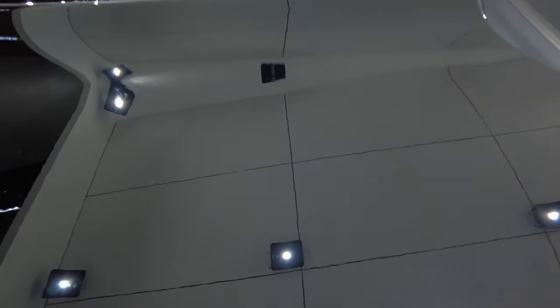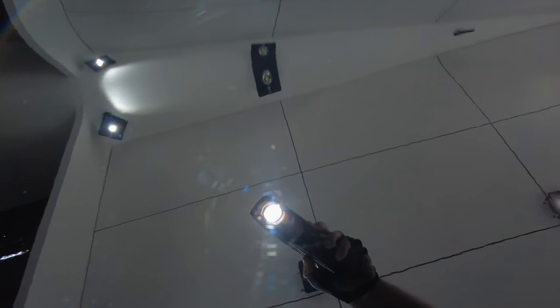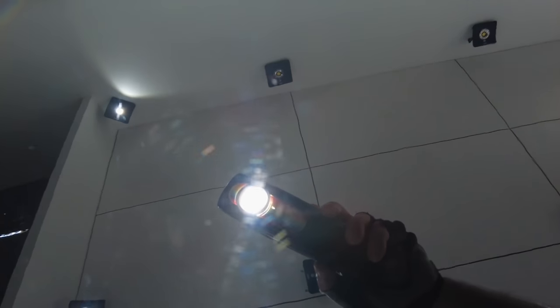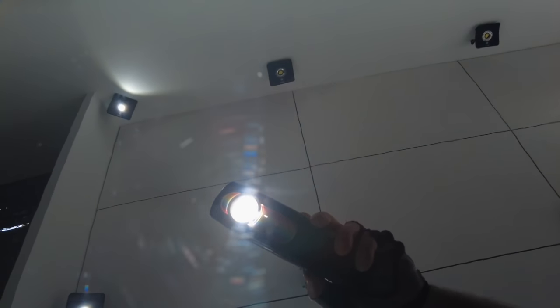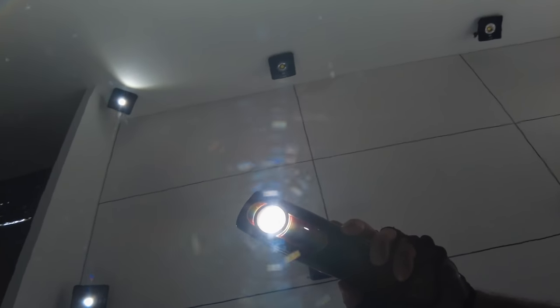Now this section actually had the best balance of cut and finish of all the tests so far, and if I was doing a quicker one-step polish, it could actually be a great option. But since I'm looking for a higher end result for my client, it still falls short, maybe achieving 75% or so defect removal, and I can also see some slight haze in the finish, which could definitely be better.